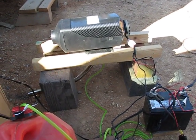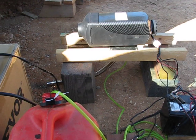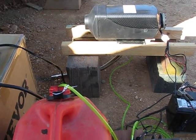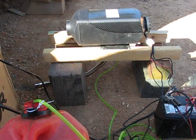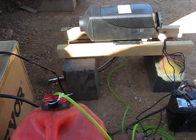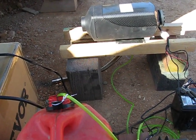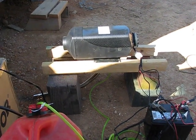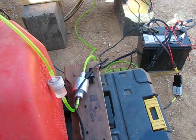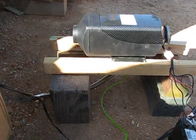There's a glow plug in here that takes about 15 amps to get it started, and then it runs on less than half an amp when it's going. I was hoping it would turn on soon - didn't want to make a fool out of myself. It was silent at first, then the fuel pump started ticking. I think it was waiting for the glow plug to heat up.